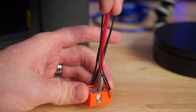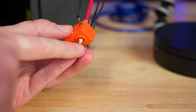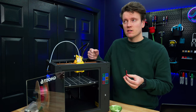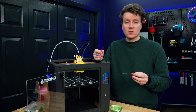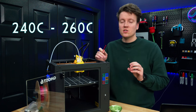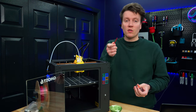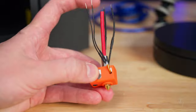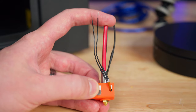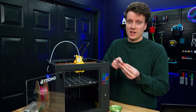The other downside is that it's a PTFE-lined hot end — the piece of PTFE goes all the way down and touches the hot nozzle. That's not great for high temperature printing, which is kind of what you want the enclosure for. I wouldn't recommend printing ABS more than occasionally on here because at higher temperatures — around 240 to 260°C — PTFE starts breaking down and releasing some nasty chemicals. I would recommend changing this out for an all-metal hot end, and I did email Flying Bear to see if they sell one — I'll put that link in the description.